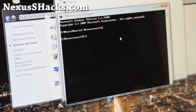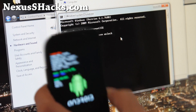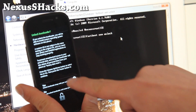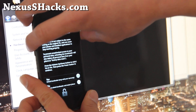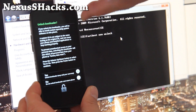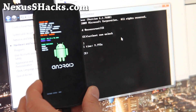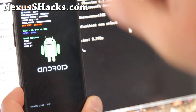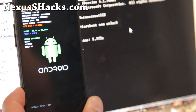And we're going to type fastboot OEM unlock. This will unlock our phone. Choose yes by hitting the volume up button and then the power button. And you'll see that it's unlocked — it says unlocked. And then we're good to go.